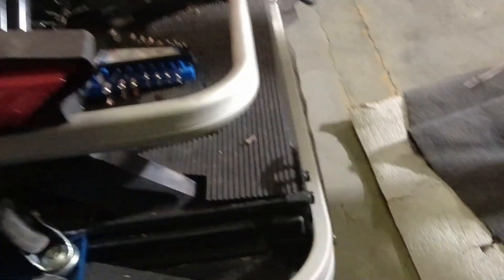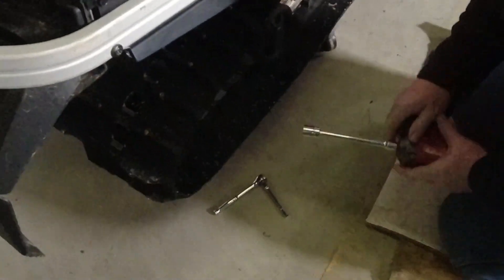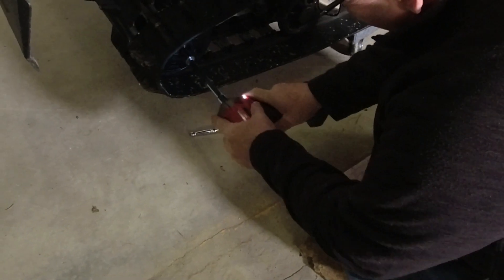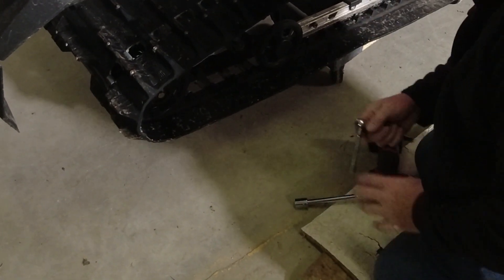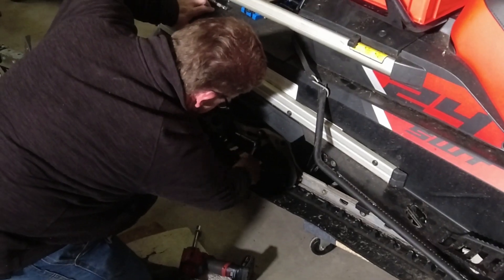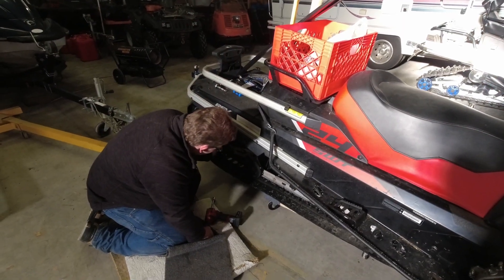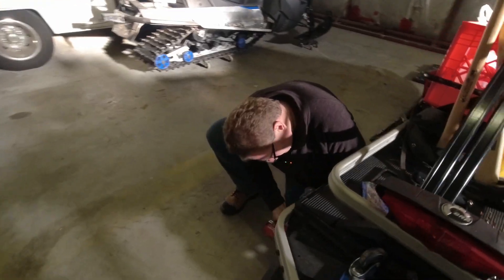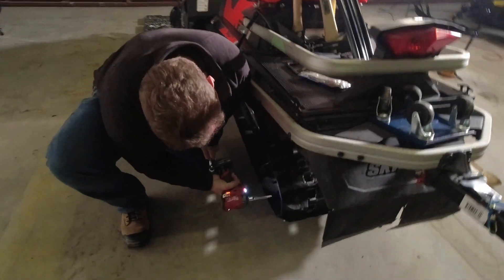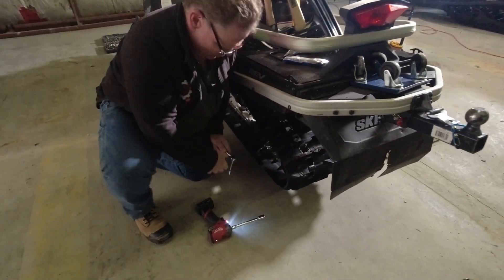The third adjustment we need to make is at the back. We've slacked that wheel off, then we take our quarter drive - a little bit of slack - you can see the wheel turns fairly free. Repeat on the other side. We don't need to take those wheels right off.